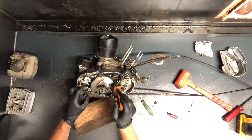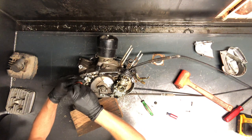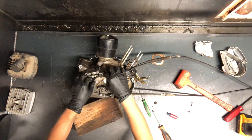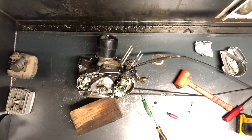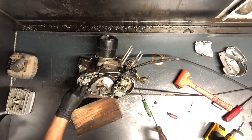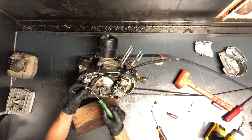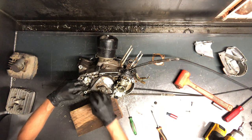We've got an oil pump here. Here's your oil line running back. We've got two Phillips screws that'll remove this oil pump. We're going to undo that oil line now to get it out of the way — that takes an 8 millimeter to remove. Sometimes when they're this old they're extremely brittle and difficult to come off. So we've got a banjo bolt we can take out — they call it a banjo because oil flows out the end of the bolt and through the orifices. Just make sure you've got a crush washer on either side of that.